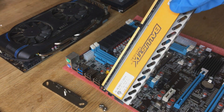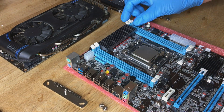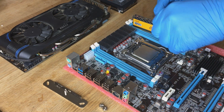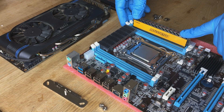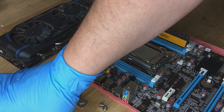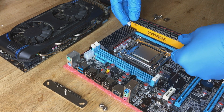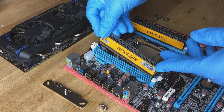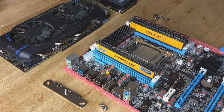Next step, I'm going to be installing RAM from my old build, which is some Crucial Ballistix memory — it's DDR3 1600 MHz RAM. I've got three sticks so it's going to be 12 gigs going in here. Make sure you get it the right way around, and it should just snap into place — you should hear a click. That's the RAM installed and the processor.